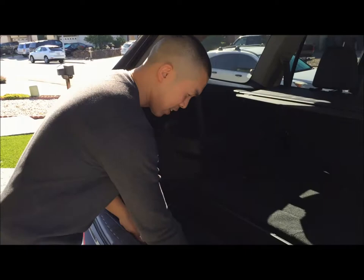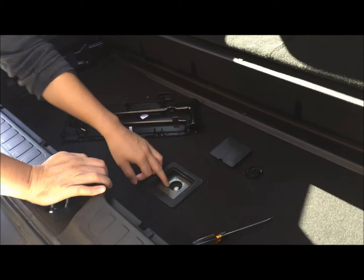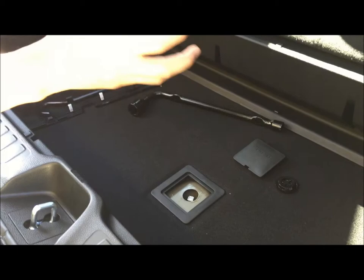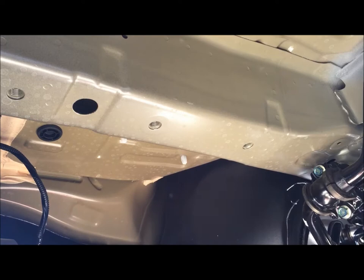Before you start, you have to take the spare tire out. You need a screwdriver to knock off this plastic grommet — when you knock off the grommet, you'll have this weird-looking square piece. You then take the lug wrench from the side of your car, use this stand, and turn it. There's a little silver wire that lowers the spare tire down, and then you take it out. To lower the tire go counterclockwise; to raise the tire go clockwise.